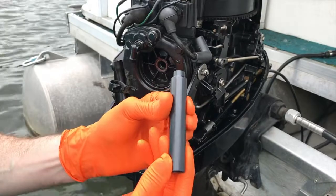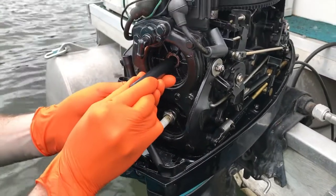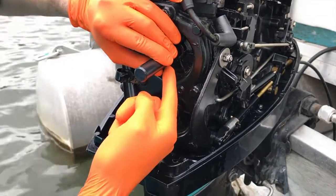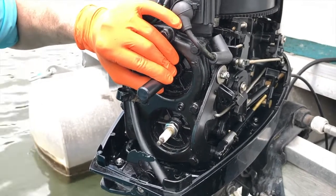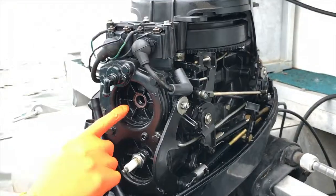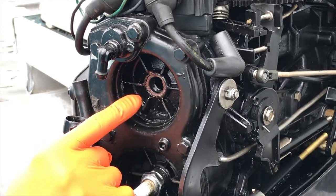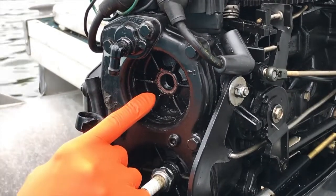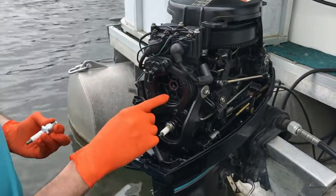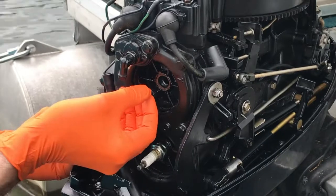The next step uses a tool with a tapered tip. Insert this into the hole and hammer it in place. The reason we hammer it in is to give that knurled section a chance to bite into the internal portion of the hole and thread so it never comes out. After that, we have to allow 24 hours to pass before starting the engine — that gives the gasket maker and high-temp sealant time to properly cure. This is under extreme pressure and you don't want any leaks. That knurled section tip is now engraved in the inner portion of the hole, and that's going to allow that insert to always stay inside when you pull the plugs in and out.